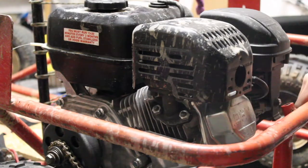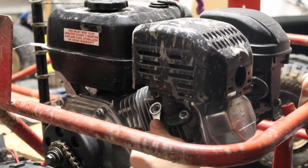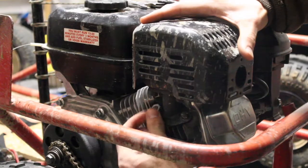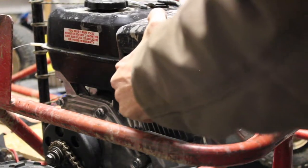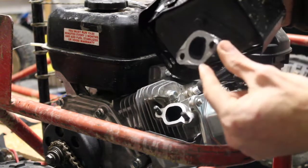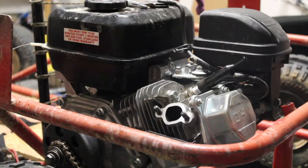Okay, we're going to start by removing our muffler. We're going to be using a 13 millimeter wrench. Now you want to make sure whenever you pull this off that you're really kind of easy with it, unless it's real stuck. Reason being is there's a gasket between your exhaust and the head of the engine, so you want to be real careful with it. Here's that gasket I was talking about — I've got a spare one, so I think I'm going to replace it. You can see how it kind of started to separate right there.